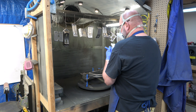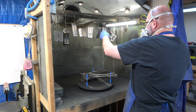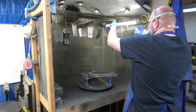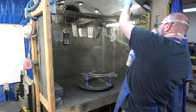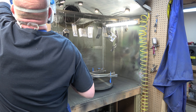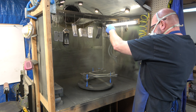In part 5, I masked off all of the parts that were getting painted, so the first thing we're going to be doing is applying a self-etching primer. I like the Rust-Oleum Automotive Self-etching Primer. You can pick it up at just about all your big box stores, automotive stores, Walmart. I just shoot this stuff on. One coat is enough, and I'll set it aside to let it dry. It takes about 10 to 15 minutes to dry to the point that you can handle it, and that's also the window that I start painting.